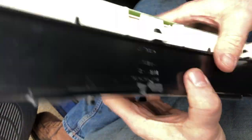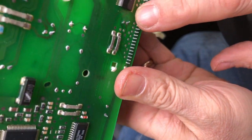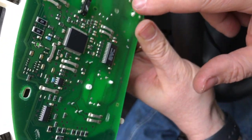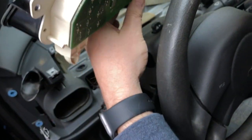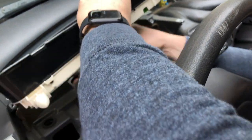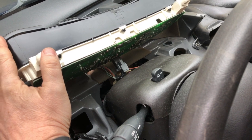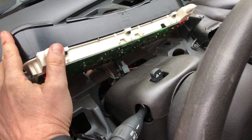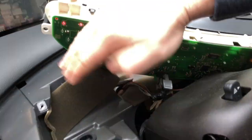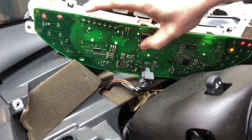The suggestion is that the bulb here is burned out — you can see the round outline and the two pins. There are a couple of these bulbs: one there and one there to light up this particular gauge, and others around the cluster. What we want to do — the reason I asked you to note how that connector goes back in — is we're going to hook this back up to test it. We need it to be kind of dark to see which bulbs are burned out, so I'm going to pull it into the garage.